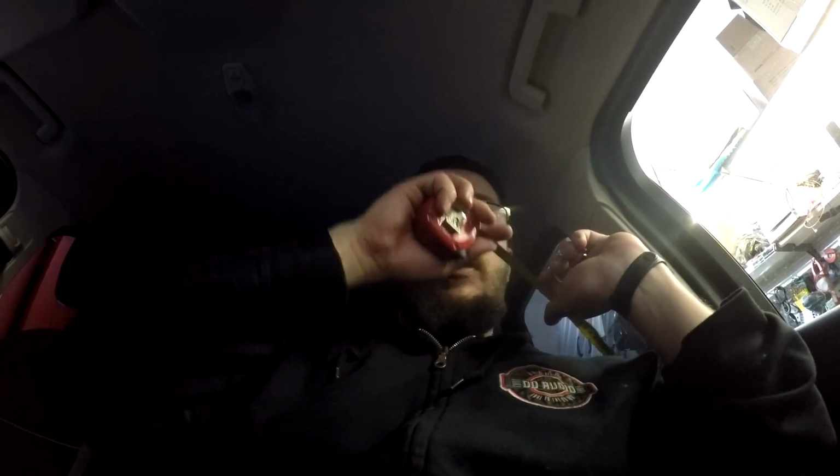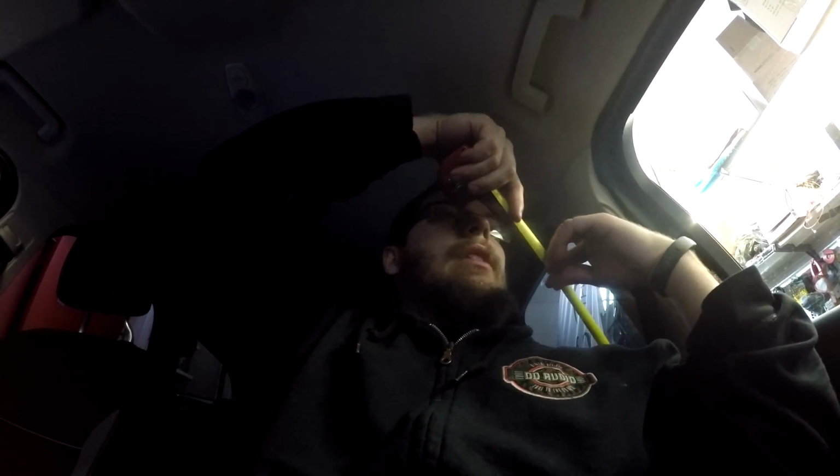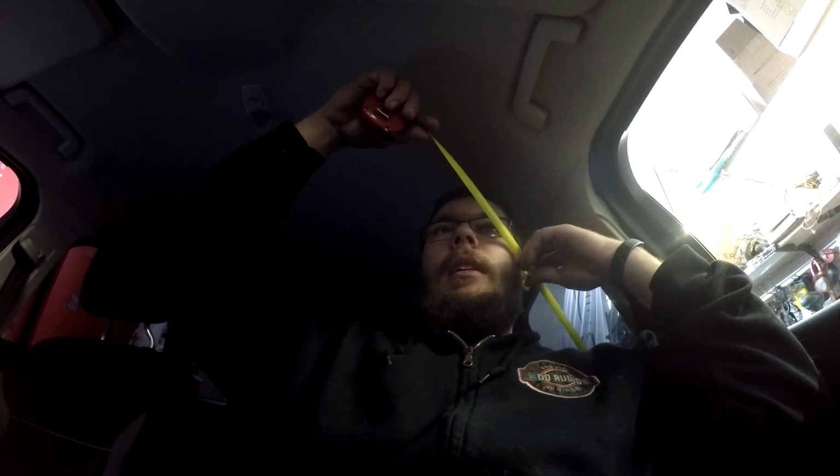Now I have made these many times, like 20 to 30 times, and I know that the stereo image is around up here, because the tweeter is normally up in here, or the mid-range will climb up the door and sound like it's up in here in the door. So I will be setting only 37 centimeters to rear left. 37 centimeters, oh, 39, 37. And then the right hand side will actually sound like it is coming from the back seat. So I will be setting the time alignment around here. I will be driving like so. It will be 114 centimeters.